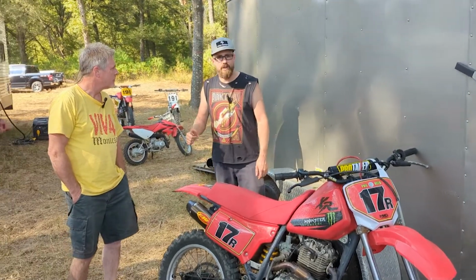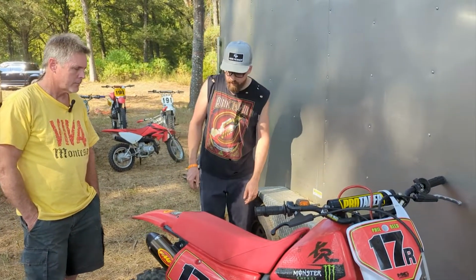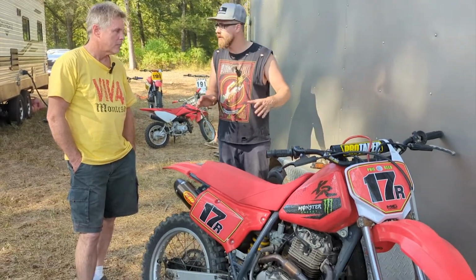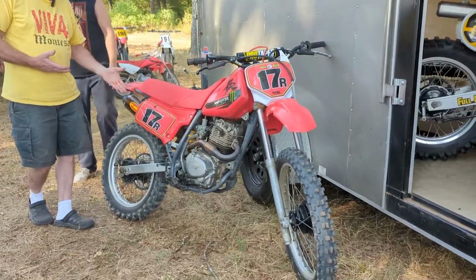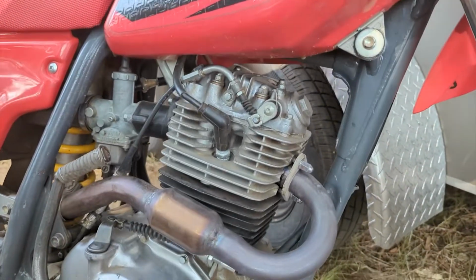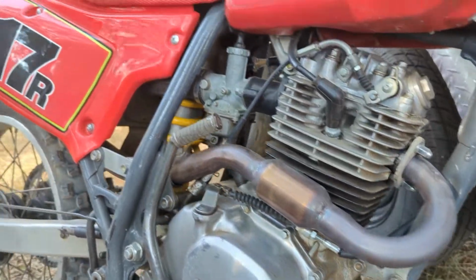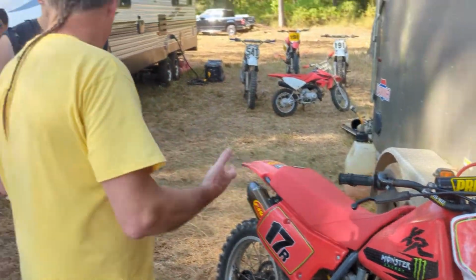All right, I'm with Phil Reed. He's going to talk to you a little bit about this XR200. But first of all, what have you done to it that makes it a little special, or maybe made it run a little better for you? Okay. Like most people, I put a different pipe, different exhaust on it. 12.5 to 1 compression on the cylinder. Did a little bit of massaging on the porting on it. Of course, it has a cam. And that's pretty much standard fare for most everybody else.